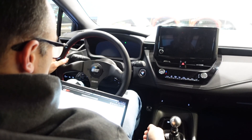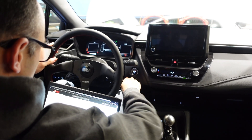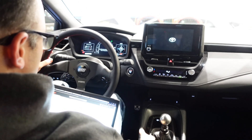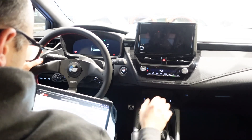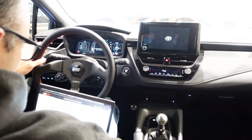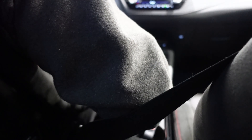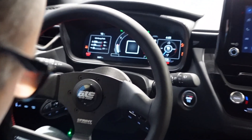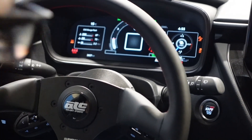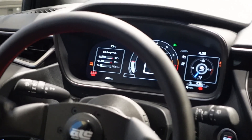Engine is off, handbrake is on. Turn the ignition switch on, release the handbrake, press the brake pedal and hold, turn the engine on, pull on the handbrake, release the brake pedal and press two times and hold — one, two — release the handbrake, then pull two times and hold — one, two — release the brake pedal and press two times and hold — one, two. There she be! We are now in dyno mode. Let's do some dynoing.